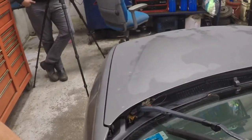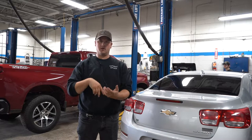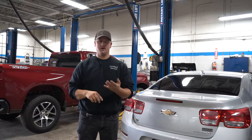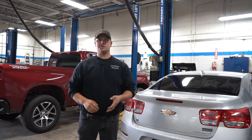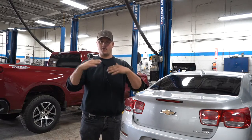So we're going to assume we've got the new blade. You're going to put on this U-hook style clip, slide that up in there until you hear the click, and then you're good to go. Turn your key back on, allow the wipers to park, and that's how you install a wiper blade on these cars. A couple of things to keep in mind when buying wiper blades: if you're getting a universal set, flip the package open and look on the back to make sure the style blade you have is listed. Most places you buy blades will have a catalog — some sort of interactive iPad where you can go through a year, make, model selector. If you're at a spot that doesn't have that catalog, length is really important. Driver and passenger side on some cars are different lengths, and if you swap them around you can actually damage your wiper blades or your wiper motor transmission when they overlap, depending on how the wipers run.